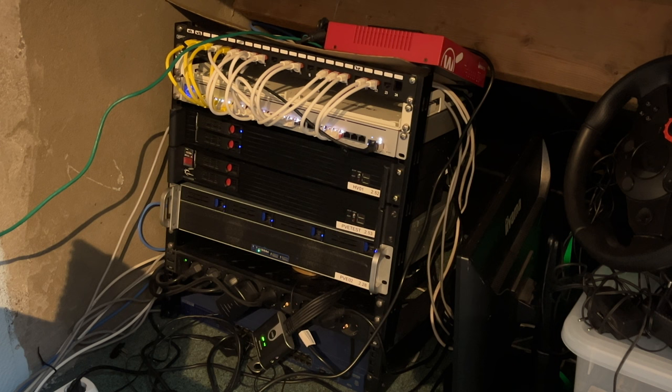And the TDP difference is of course quite stark. The 10600 is, I believe, somewhere in the neighborhood of 70 watts. I'll put a correction on the display if I'm wrong, I'm doing this from the top of my head. And the Intel N100 has a total TDP of 6 watts. So in pure idle mode, it shouldn't make that much of a difference, but the host is usually doing something, and especially when it's going to try and transcode some video, which it will need the onboard graphics for, which are a bit faster on the N100, then that should save some power.